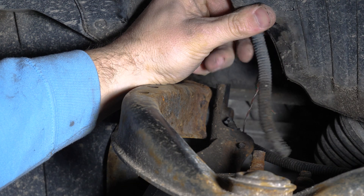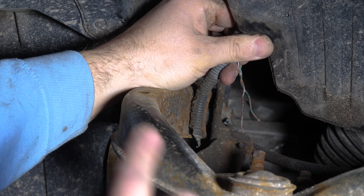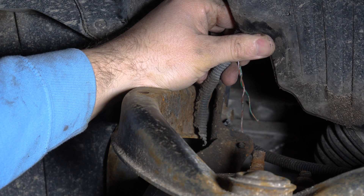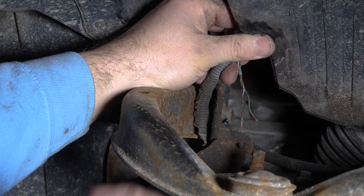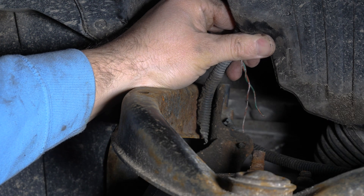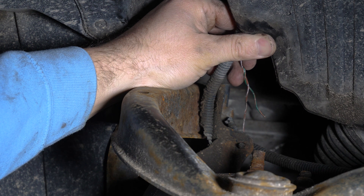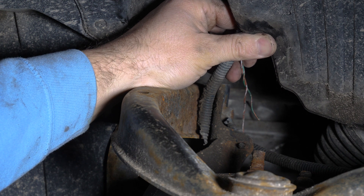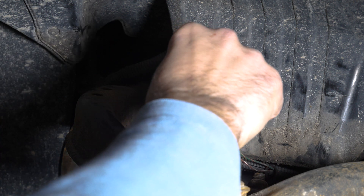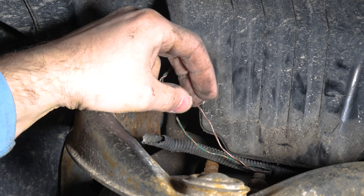That actually is really wonderful because the fact that it's down here — where there's only two wires and not up there somewhere in the big fat harness — makes me quite pleased. So I'm going to disconnect both of the little clips holding this on, get both ends, connect it back up and see if we have continuity. I'm going to go grab one of those solder connectors, do a nice clean cut, lay them over, and then test again.